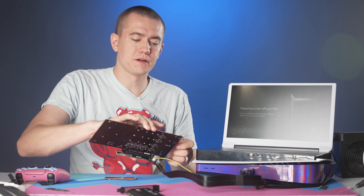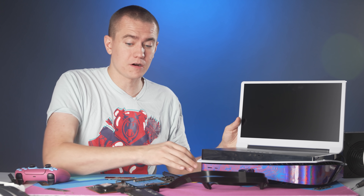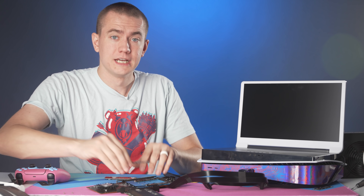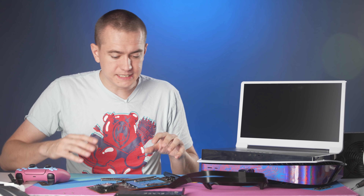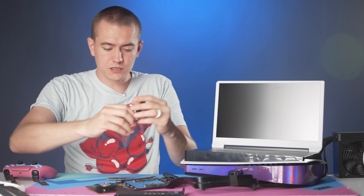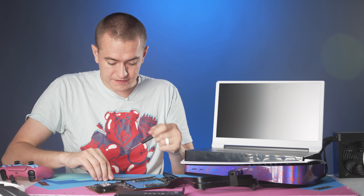The thought was that this could be a RAID card added to a PC, and I wanted to try it on the PlayStation. But the issue is that on a PC it would be software RAID, whereas with the PlayStation I'm going to need a hardware RAID solution — which is exactly why I have this WD Black drive. If this card is only using one of the x4 lanes, it's only going to work on one of those slots, and I'm not 100% sure which one it'll primarily use.